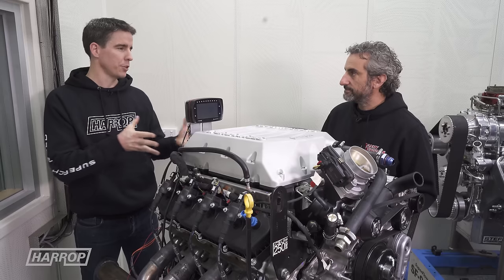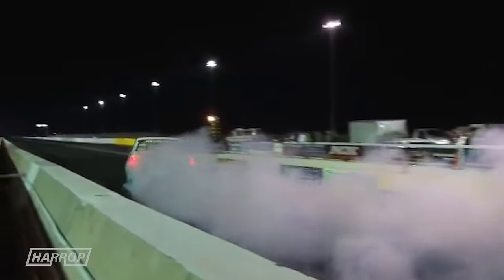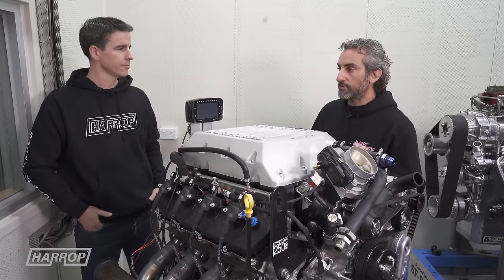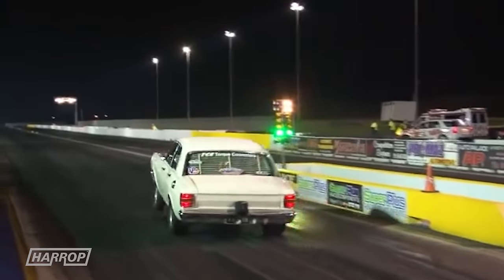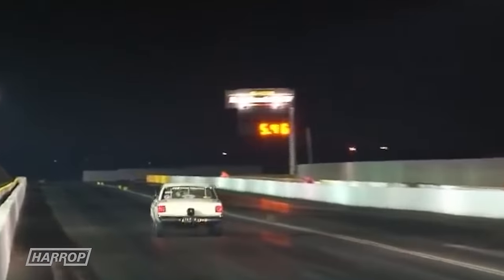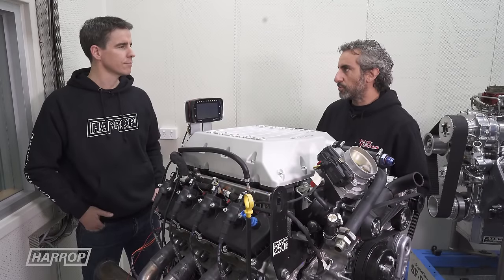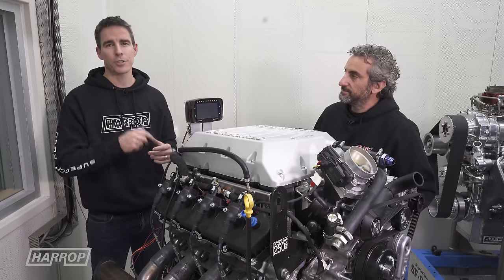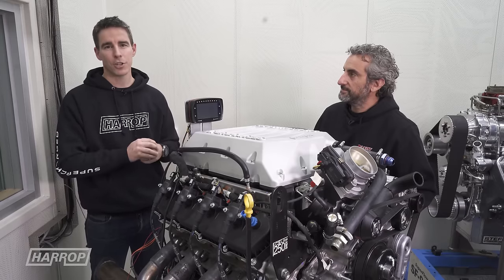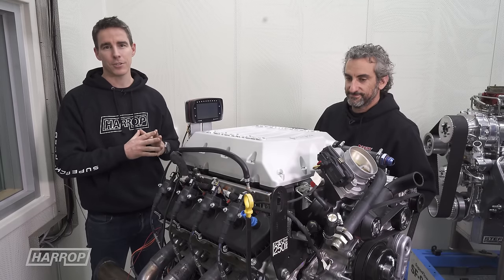So with that level of performance, what do you see for your customers at the track? I've had an 800-horsepower engine in the Dandy Engines XW with 200 foot-pounds less, and it ran nine-sixes at 140 miles an hour — it was about 3,500 pounds. This has got 200 foot-pounds more, so I think the converter should work even better if it's an automatic car. It wouldn't surprise me if it ran 9.50s. So pretty impressive numbers for phase one — we're excited for phase two. Hit like and subscribe to the channel and we'll be back very soon with the next step in the power and performance of the 7.3 Godzilla.